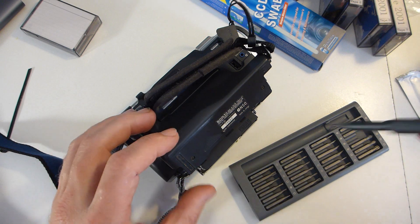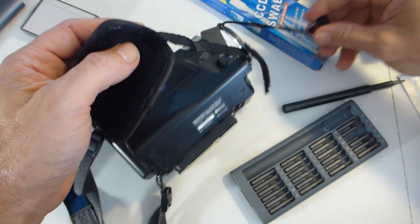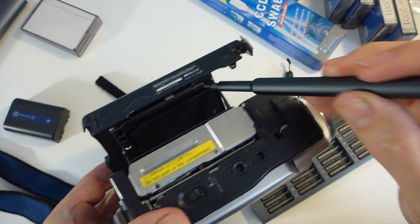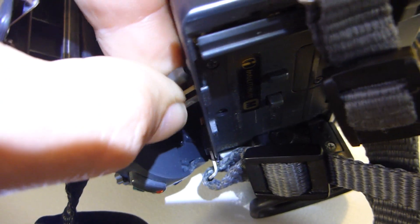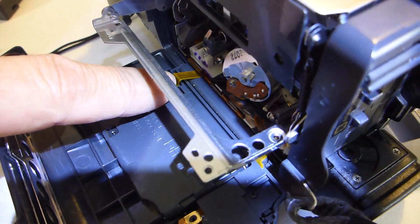Got my trusty jeweller's screwdriver kit. I haven't done this in a very long time, not since I bought the camera. I've got to work out how to get inside these little ones here that you probably can't see. There's a ribbon cable down there. These top ones were pretty simple to get out, as was a screw in there, but this one is a little bit tricky. I've had to take the head off my screwdriver and twist it by hand — and it is slowly coming out. When that screw comes out, this mechanism, which is quite floppy, becomes loose and the door just folds down. But you can see there's still that ribbon cable there that has to be considered and really protected.